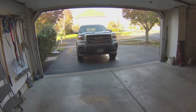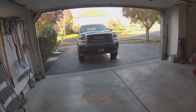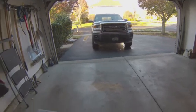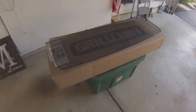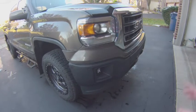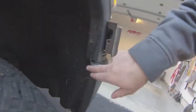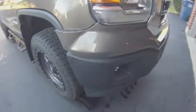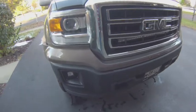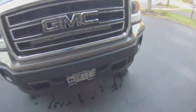There are about a billion videos on YouTube on how to remove the grill off these trucks, so I won't film that in detail. But here's a quick rundown: you've got some Torx screws and a 7-millimeter bolt here, plus one tucked up inside. Once you remove those four screws, you can pull the front bumper trim off — do the same thing on both sides. Then go underneath the truck, there are four tabs underneath, and the whole piece should pop right out.